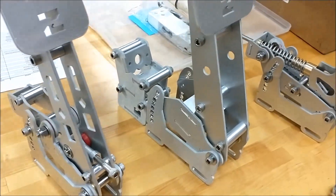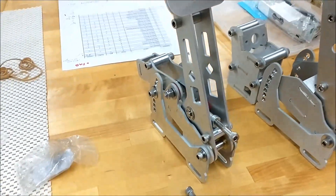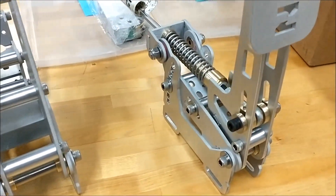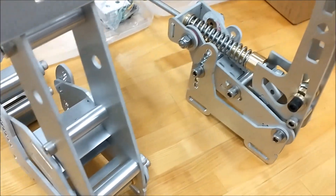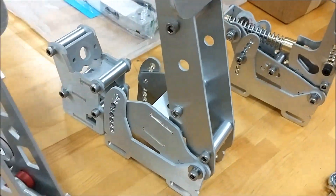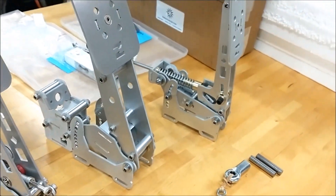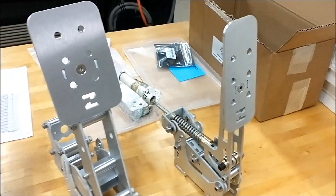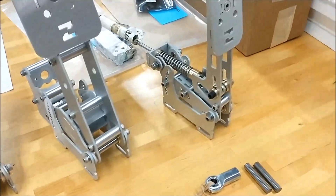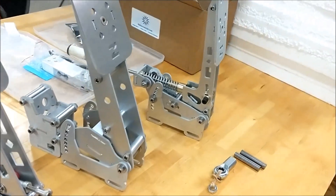I've got to tell you, there are 99 different types of adjustments on these things. And by the time these are fully assembled and in position, they will have load cells all the way throughout to monitor pressure, stroke, and range. They'll be tied into a computer that will give adjustability to the person driving at that time. If you want a hundred percent gas pedal and it only moves an inch, well then that's a hundred percent — and you can change that and adjust it on the fly.